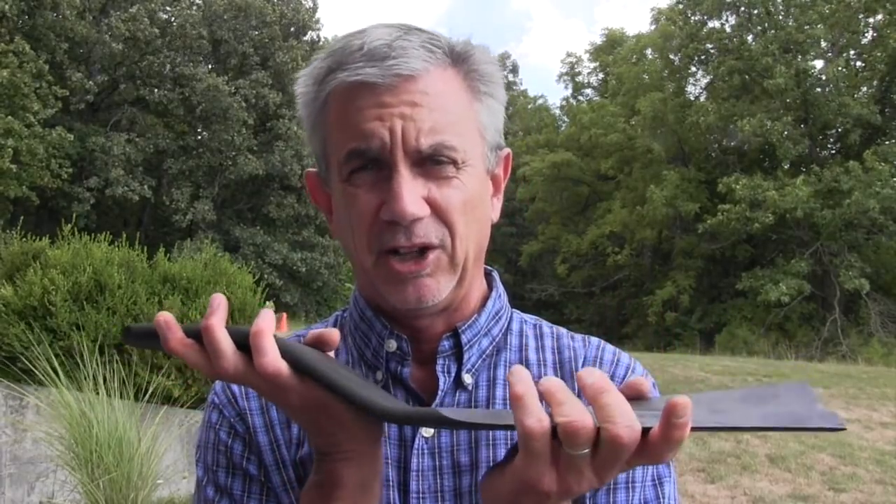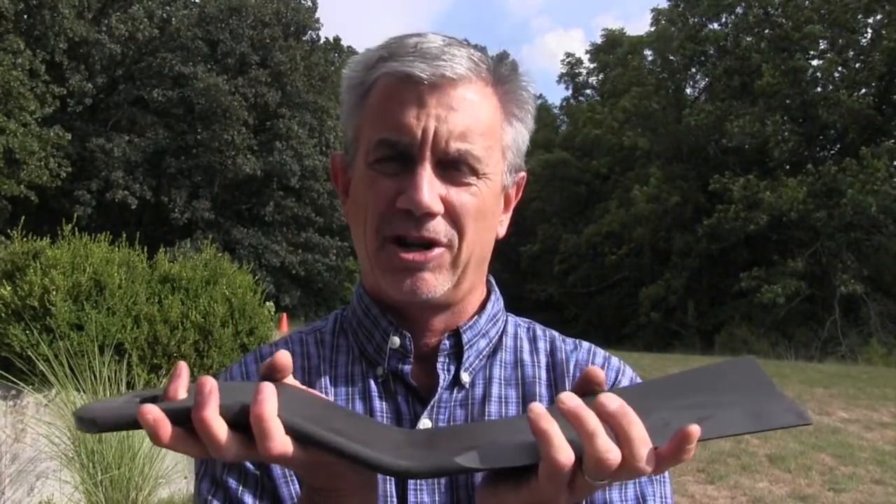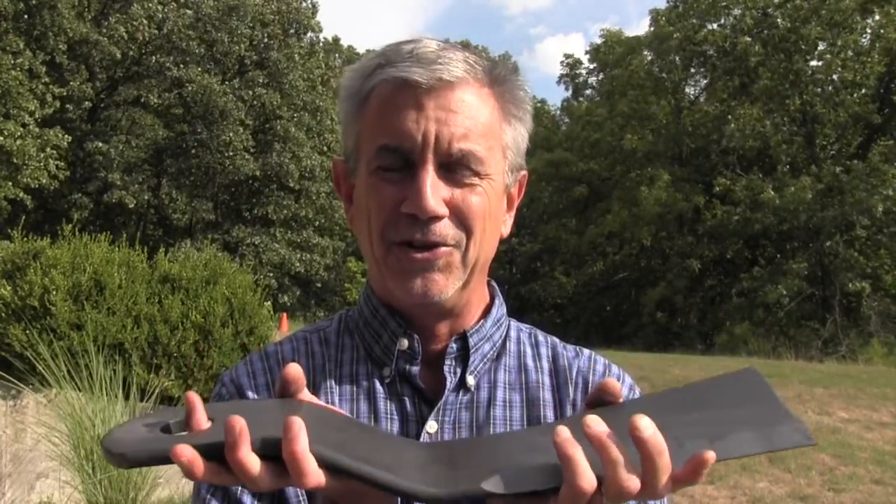When you get a couple of those blades spinning at high speeds and one of them is bent a little bit, you can't straighten these blades. Once it's bent, it's going to throw off the weight ratio on the two sides — the centrifugal force — and it's going to vibrate so badly you better replace it, because it'll damage your cutter if you leave it that way. So the second time to replace a blade is if you bend one — you'll sure know it when you hit something, and you'll know it when you turn the brush hog on because it'll about throw you out of the tractor seat.